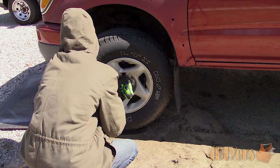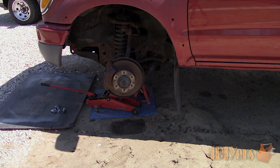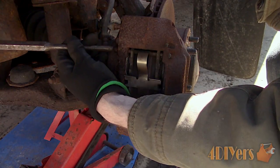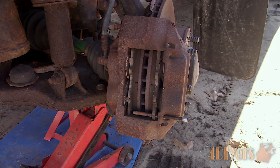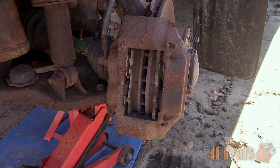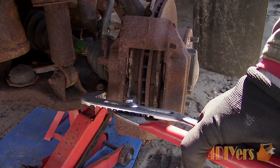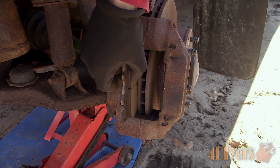Moving on to the opposite side. Jack up the truck and use jack stands to hold it safely, then remove the wheel. Remove the wire spring retainer for the pad pins. This time I'll show you what happens when the top pin is removed first — using a punch, tap out the pin, and as you can see the anti-rattle clip's spring tension will make it fly out on its own. Remove the other pin. Using large interlocking pliers, depress the pistons — the master cylinder cap should still be open to relieve any pressure. Lift out the pads, and again, if you find any binding you will need to clean up the caliper using a wire brush.